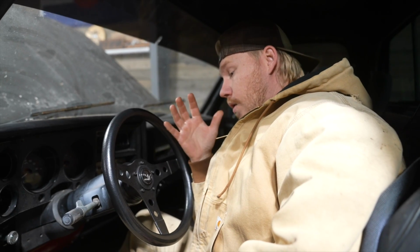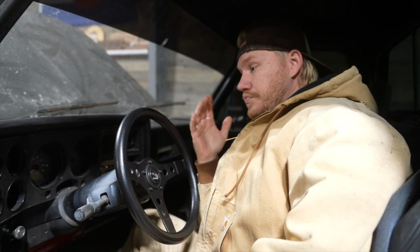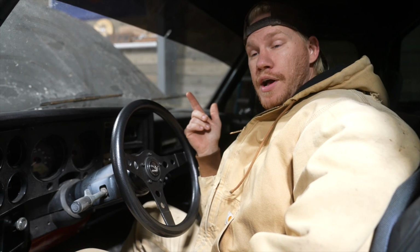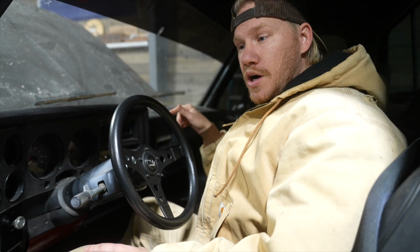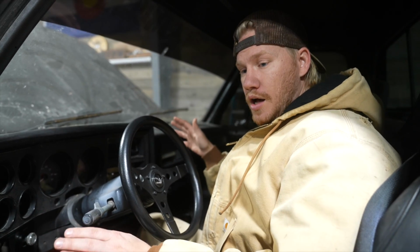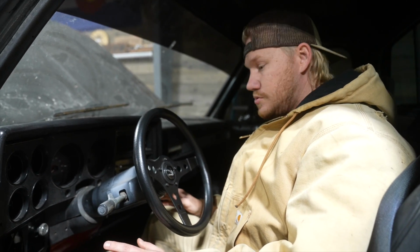So now I'm driving and the truck ain't shifting. I'm wondering what the hell's going on. Is it another transmission issue? Because if you guys remember correctly, I have a TH350 in here now, but originally had a 4-speed Bulldog manual. And then I got a TH400 reman from a buddy that supposedly worked. It didn't. The pump was out. The clutches were slipping horribly, and it wouldn't work.